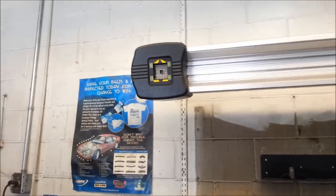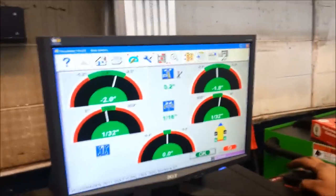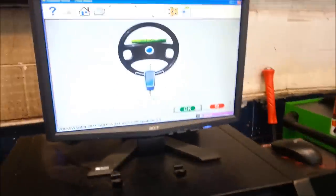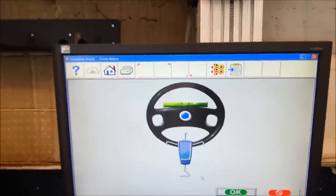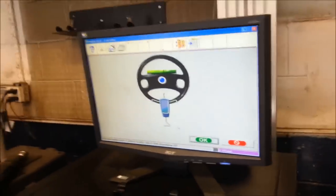As you can see we're all in the green. The rear alignment looks good — it's perfect, all good. Those red dots just detect the cameras. So your rear line looks good — perfect. My front end is out of alignment. The toe is off — I've got quite a stance going on right now. It was out, so good thing we checked. Tariq is going to have to set my toe, and we should be good to go.